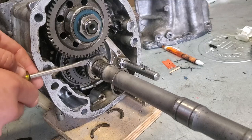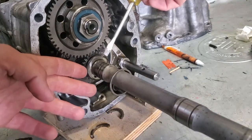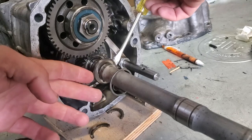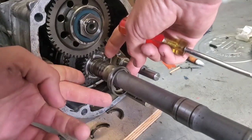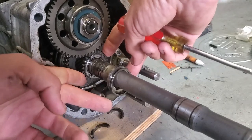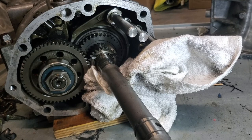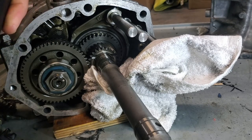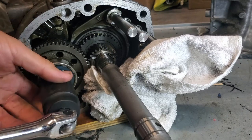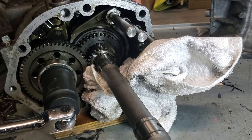We've got this washer right behind it - carefully slide that off the assembly. Now we've got access to the reverse gear and fifth gear assembly. We are going to remove the countershaft bolt off the top of this bearing with a 32 millimeter socket. I jammed a rag in the gears to keep it from turning the assembly.